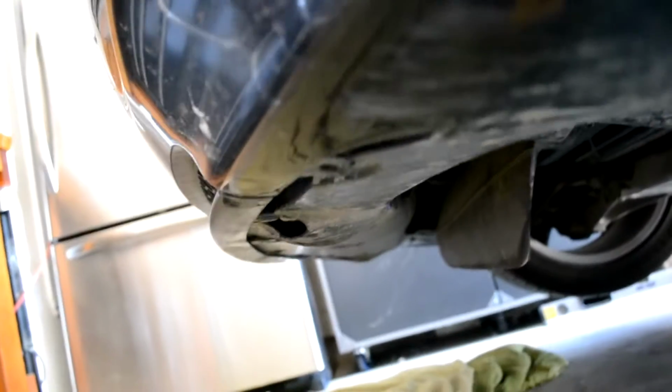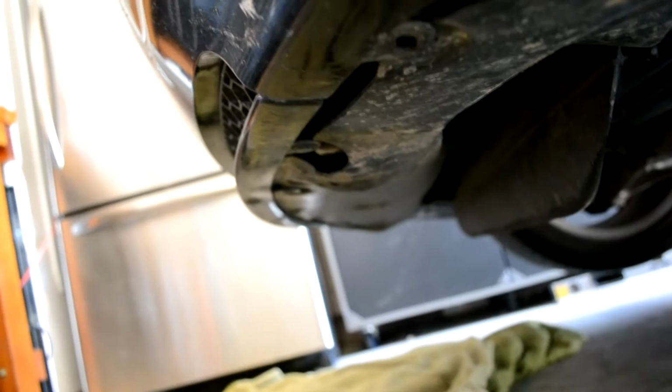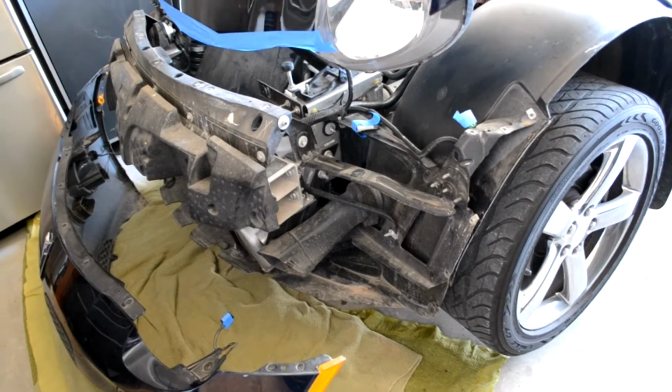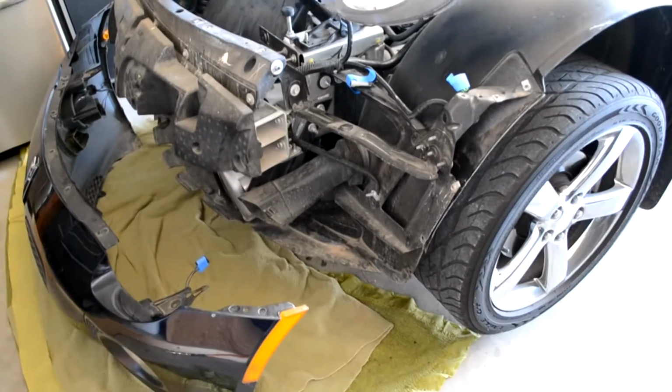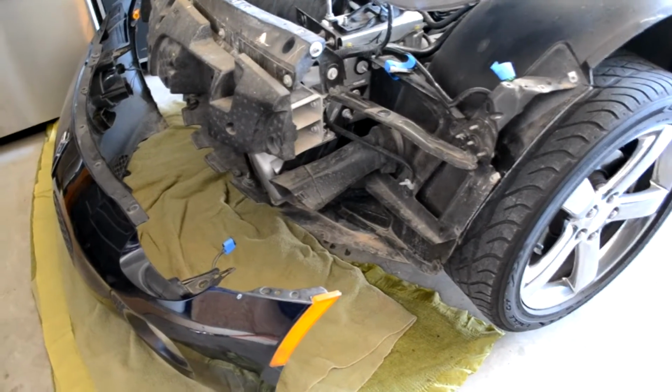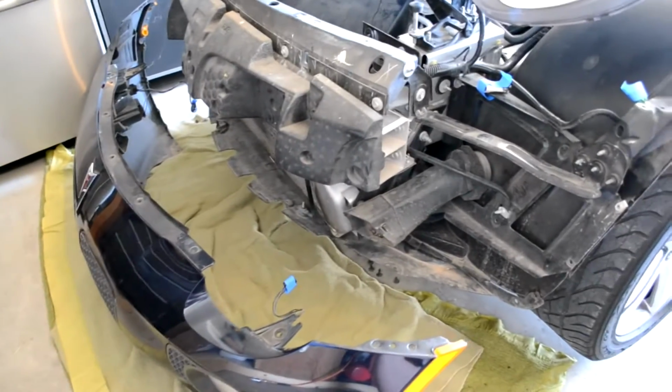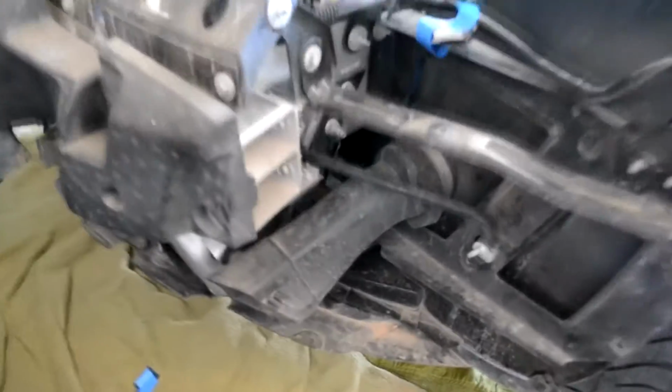Also, I've worked across the bottom, and I took out 4 plastic plugs that hold the fascia in to the bottom of the plastic in the car. I took the screws out of the other side, and after that I was able to gently pull the front fascia off, revealing the bumper system behind it. You'll see that the brake ducts stayed in place.